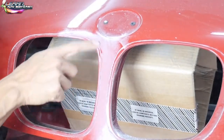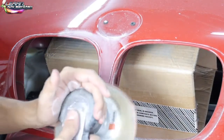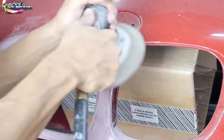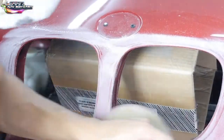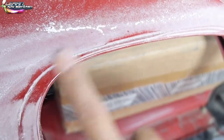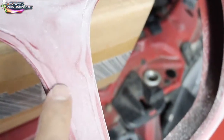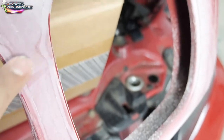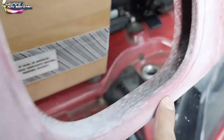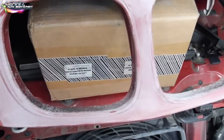You can see right away all the old clear and the high spots as we sand. I want to pause and show you how it's cutting — you can see the old clear coat and some of the runs here. The goal is to make it all flat. As long as it's flat and there are no shiny areas, we're good. We just want to go over all around it, get it nice, so when we put a fresh paint job on it's going to lay on really really well. Then we'll proceed to take out the rock chips down below and across the top of the hood.